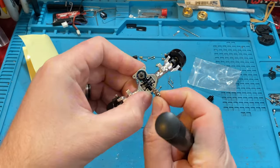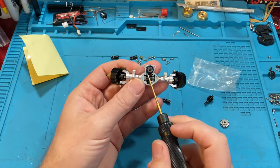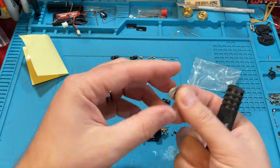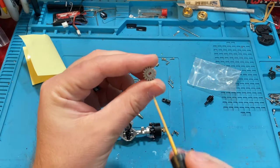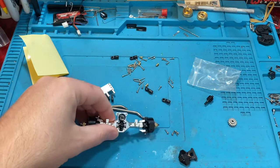The axle shafts will not go in with stock gears or any aftermarket gears meant for a stock axle, because they don't have those flanges. So you can't change the gear on the front, unfortunately. But that's why they included the overdriven front, so you can put the stock in the rear. The rears can use stock or any aftermarket gearing because the shafts aren't sliding in and out — they just stay keyed right into the gear.